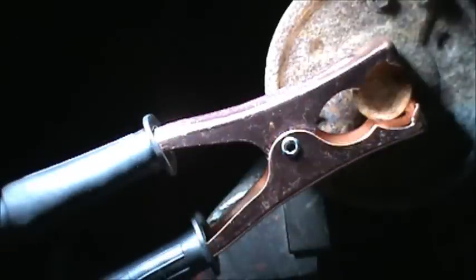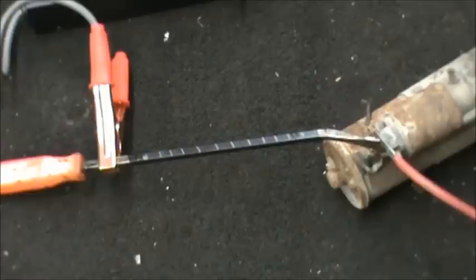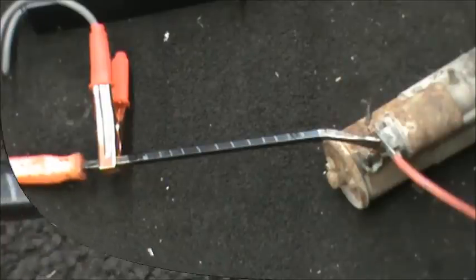Place the black lead of the battery load tester onto a good ground of the body of the starter or the engine block. As is often the case, the hot post on the solenoid is inaccessible. Connect the positive lead of the load tester to the bottom of the pry bar. Then touch the top of the pry bar to the solenoid. The shaft of the pry bar has been wrapped with black tape to avoid inadvertent shorts.